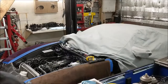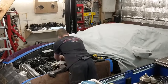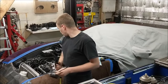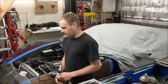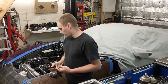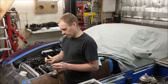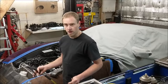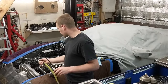I guess I'll get started here. So, as far as the cylinders go, the water jacket that surrounds them is just filled with coolant, right? I have this little plastic hose. The hose is pretty small. It fits right inside the water jacket there. And then I take my air nozzle and I hit it at a certain angle, just enough to create a siphon effect until I get fluid moving. And then I can just let it drain down into the pan below. So that's kind of what I do every time I pull one of these off. It helps with not having antifreeze constantly fighting you every time you do something. Just makes life easier.